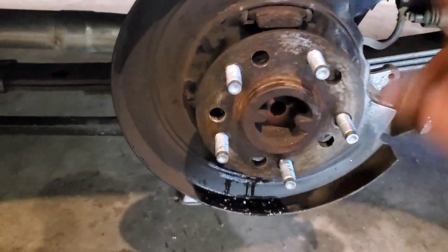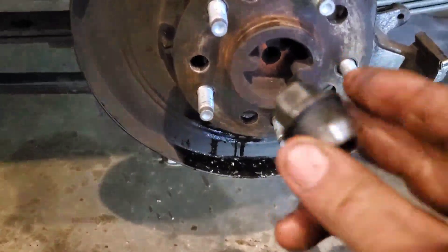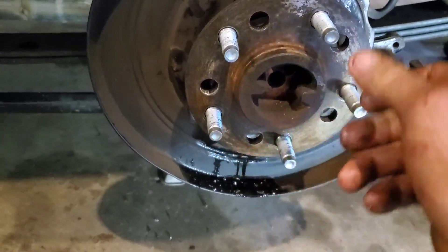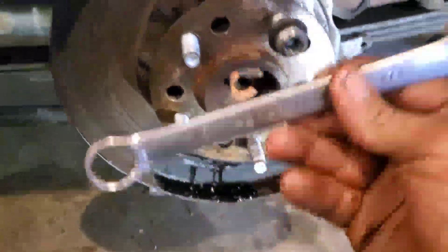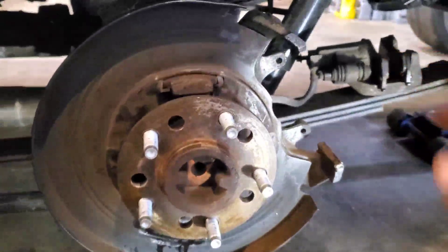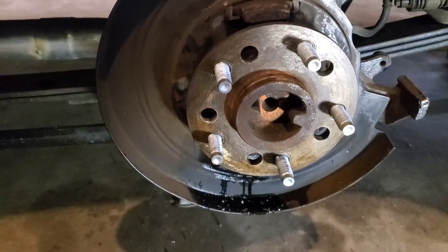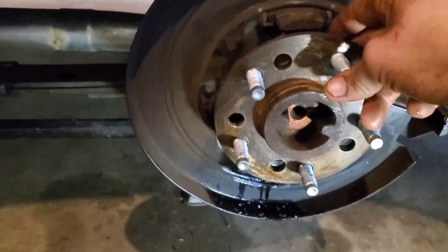I got the holes all drilled and the wheel studs already in, just barely in. I took the nuts, put them on backwards just to pull them in — there are no threads in there, just on the inside — and tightened them up with a wrench to pull them all the way in. Then I'm going to put the rotor on, do the same thing again to pull them further in, put the brake caliper on, put the wheel on, and torque them down. By the time I have them all torqued down they should be pulled all the way in. Got to take it for a drive, but I'm not going to tonight — it's getting late and I got work tomorrow. Just thought I'd make this video to help you guys out. If you like the video, make sure you subscribe and like it. Thanks for watching, see you guys in the next one.